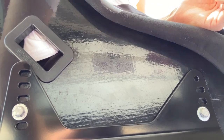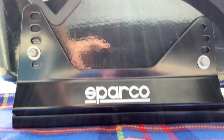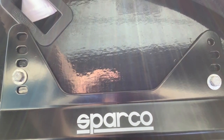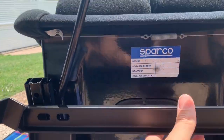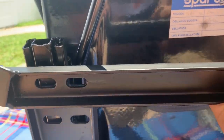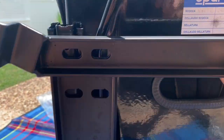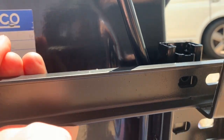I don't feel like I've got any back issues with that. If I'm too reclined I can't reach the steering wheel, especially when you're really strapped in with your harness because you can't lift your shoulders forward. Now we're going to get the base on. I'm fairly tall so we're going to set it further back. The front hole on the base lines up nicely and the back lines up in the hole just above the very bottom.